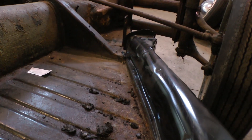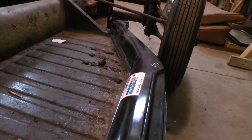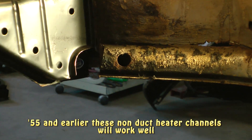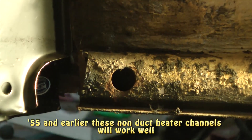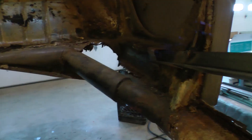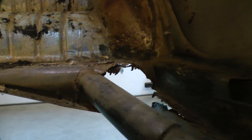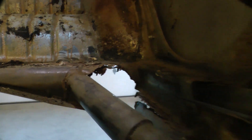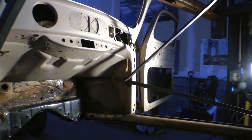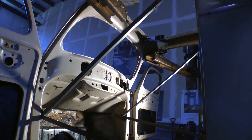They have more of the correct rounded shape. They don't have heat outlets, but we can easily add those because these earlier heater channels did not have a tube inside them — it's just a hollow tube. So we have to add that heater outlet there, and we have to add this heat pipe to the heater channel so we can get heat from the motor. But that's no big deal — we can always add that later to the channel.